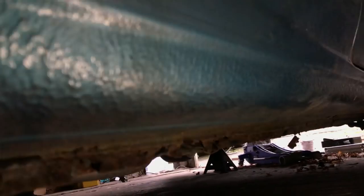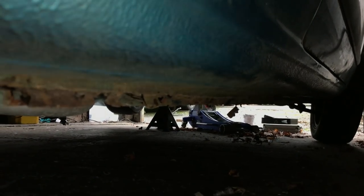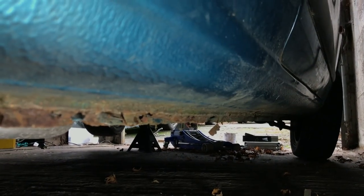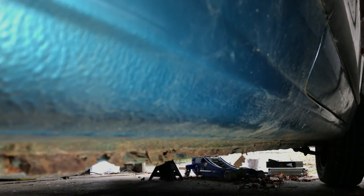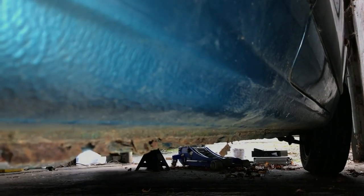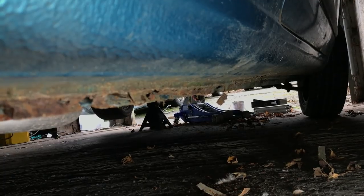As you can see this all looked really solid - it wasn't rusty. But actually when you stick a chisel in it, there is rust there. It doesn't go as far forward I don't think, but it ain't great. So I'm erring on the side of caution and bought more sill sections. But as I say, they're not going to arrive until next week and I'm never going to be able to finish the car before the weekend. Rather frustrating. But I'll have a bit more time hopefully and I can do a better job and save myself some money at the body shop.